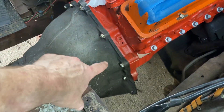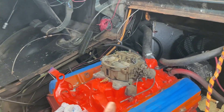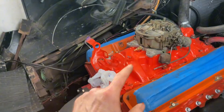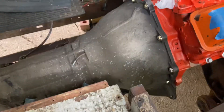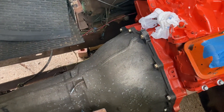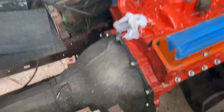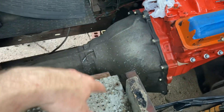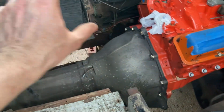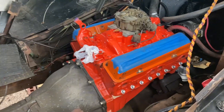I need to pick up a starter, but I'm going to do the flex plate first, then the starter, then the manifolds. The shifter I probably need to do before I do the flywheel, because I need to know what gear I'm in when I start rotating stuff. I'm so used to manual transmission — you can just put stuff in neutral. With the 4L80E, if I rotate that I don't know if it's going to try to spin the drive shaft. I need to make sure I'm in park or neutral, or take the drive shaft off. So I'll put my shifter on, know where I'm at on gears, finish the bolts and the starter, then the manifolds and then the carburetor. Sorry to ramble on and shake this camera around. Thanks for watching.